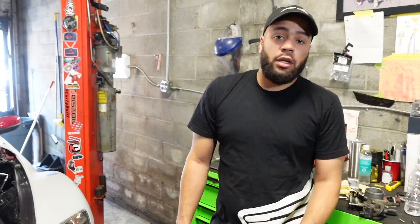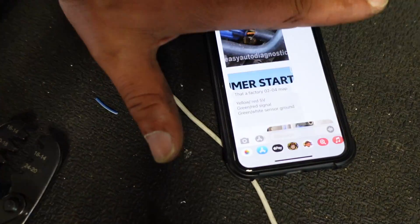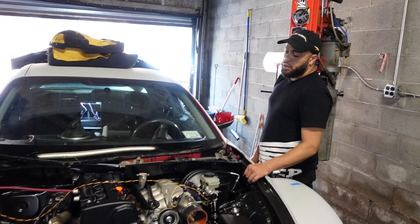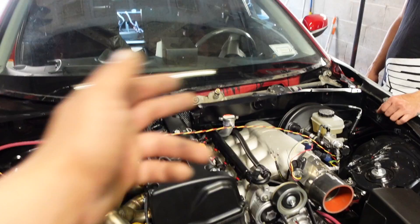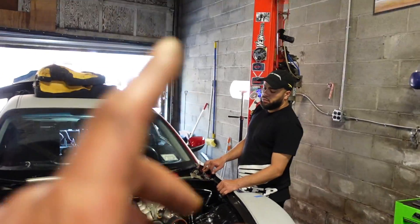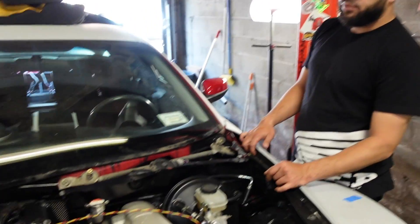We take the map sensor from Project Driver, install it on here — burn it. Burn that one too. So we're down three sensors, we're stressed out, like man, we got to make a post, we need a map sensor. Then I remember a gunner sent stock throttle bodies and I had them in the stash. We find this stock throttle body, take off the map sensor, go on Project Driver first because we were catching a misfire. Project Driver idles. We plug it into here, car is A1 instantly. The whole time for three hours, we've been dealing with burnt sensors. Huge thank you to Paul out in Jersey — he works at Toyota, great wiring guy, helping us all day.